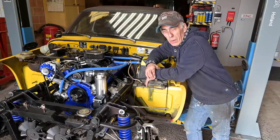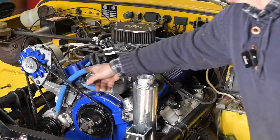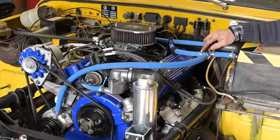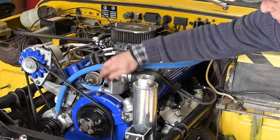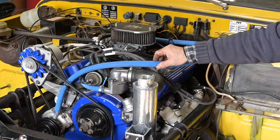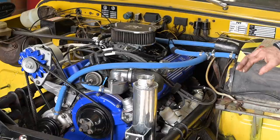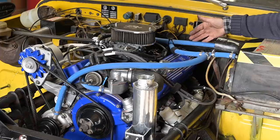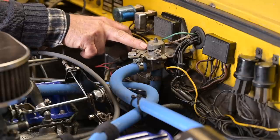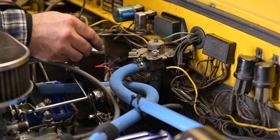It's now an hour and a half later and I finally have all the hoses in place — a bit of fiddling, but it went in not too bad. I have one hose coming from the water pump all the way up going into the intake of the heater exchanger, and the bleeding valve is right here. The other side of the bleeding valve runs back around the block into the thermostat housing. I made sure nothing is rubbing on anything and tied it down here and there. In the back we have the hose going to the heat control valve, and the hose coming back from the heat exchanger returns into the heat control valve, and on the bottom it goes back to the water pump. I still need to hook up the cable to control it.